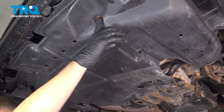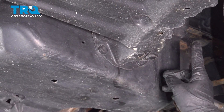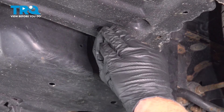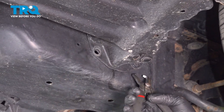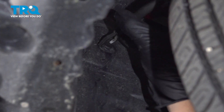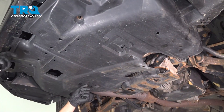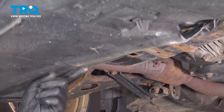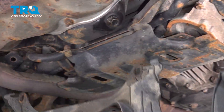There's usually one right there, but that's missing. On the driver's side fender, there's going to be three clips, two on the bottom, and one up in the wheel well. Remove those, and do the same on the other side. Once you have the clips out, there's these little hangers in the back that'll hold the shield when it comes down, and then you can just pull them off.